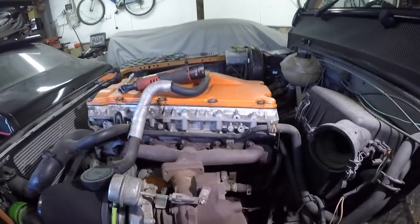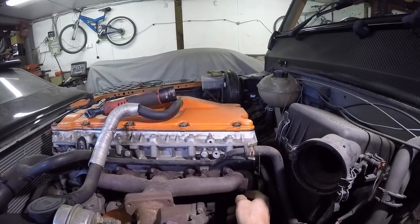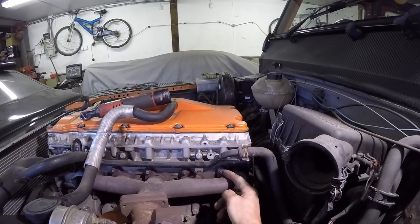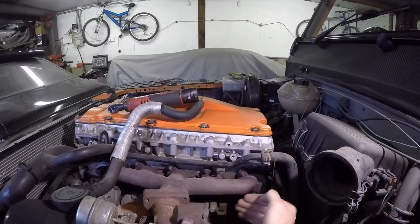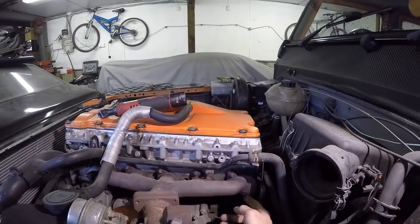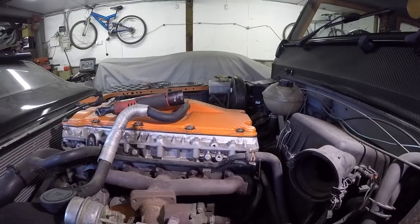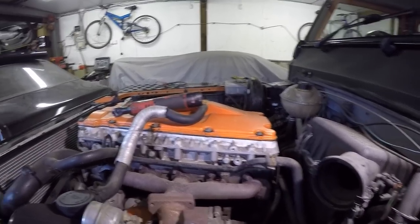Usually they pull the studs out on the rear. You can see this is blowing slightly, but it's not snapped the studs, but they either pull them out or they snap them. And it's usually the rear, sometimes the front, because basically the exhaust manifold will warp and bend like a banana. So sometimes you've got to take them out, extract the snapped stud, and helicoil the two rear ones. Other than that, usually it just blows the gasket. But I'll show you the manifold.